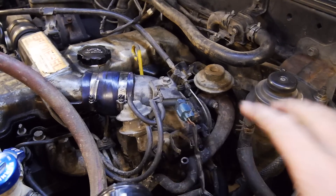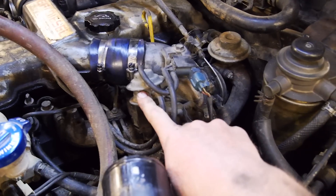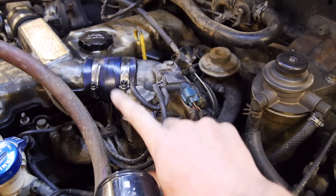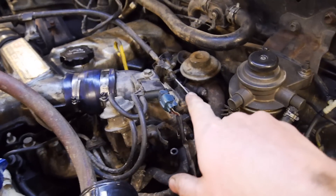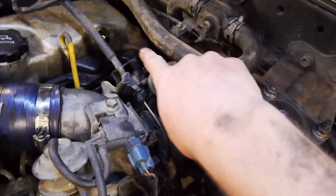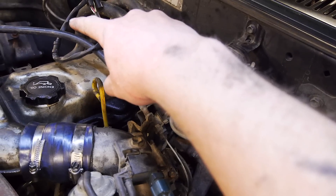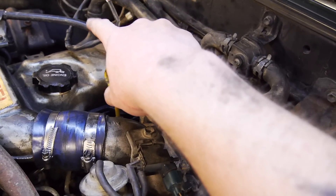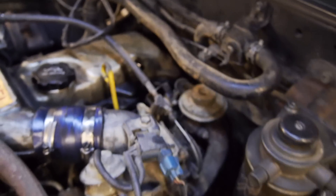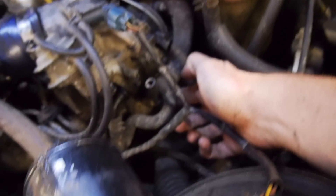This big assembly is basically your throttle venturi. You've got this little valve here which activates the butterfly — that's to create a vacuum for the EGR. This is the EGR valve over here, and from the back side it goes around to the exhaust manifold. As you probably saw, I welded up the part on the manifold, so I've just got the pipe sitting loose there which I need to ditch.